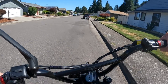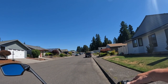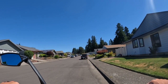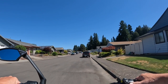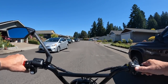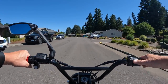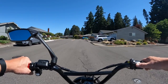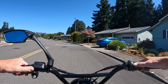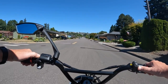I may have to adjust the wheel size to calibrate. I had to do that before on the Grizzly to get it accurate — I had to change the wheel setting to 22 inches and then it was accurate within about three-tenths of a mile per hour. I haven't checked it since I changed tires and put on the e-Huntsman. I don't think it would make a whole lot of difference, but it may make a little bit.